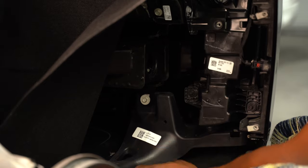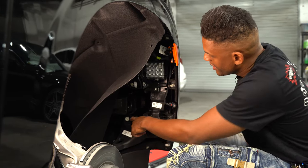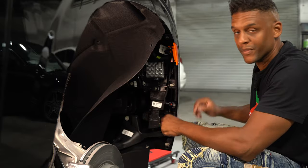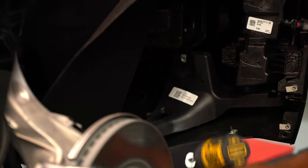There is a bracket that appears to be attached to your real bumper — the bumper support — and that bracket appears to be connected to your bumper cover. When I go to move the bumper cover it's very solid, not going anywhere. This is probably playing a vital role in the attachment of the bumper cover to the rest of the body, so let's go ahead and take it out.